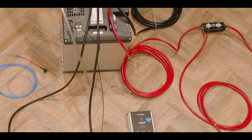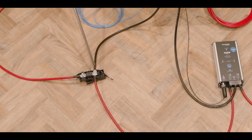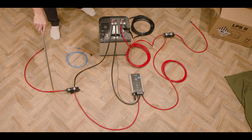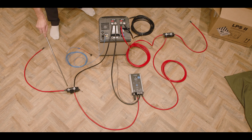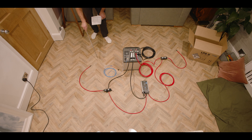On the supercharger ground, you'll come out and then go up to the DC out negative. On the supercharger out, you'll travel around into the mega fuse and then carry on up into the DC out positive. The out from the supercharger goes into the mega fuse and then up into the DC out positive. On this side, it will then travel out and go into your fuse box — i.e., your blade fuses. On your blade fuse, you'll also have a negative, and then all your connections will have a positive and negative which connect to your fuse box with different gauge fuses.